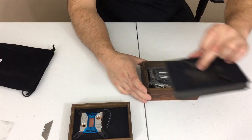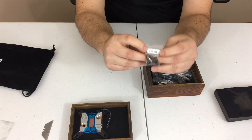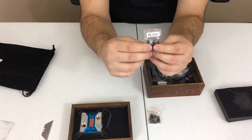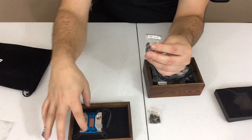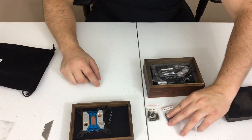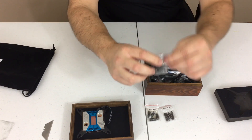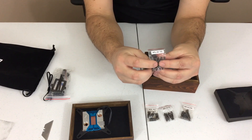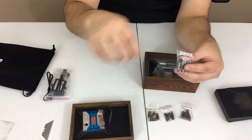We take out this bit of foam padding and we have Intel hardware. These are screws to hold down our Intel mount. Here's our Intel LGA 2011, which will also work with 2011 v3. These would screw into the back plate and come up through the motherboard, and then we would use these Intel screws to hold the water block down. Next we have our AMD screws, fittings, and socket. And then we have our Intel LGA 115X hold-down — again, these would screw into our back plate and these Intel screws would hold our water block down.